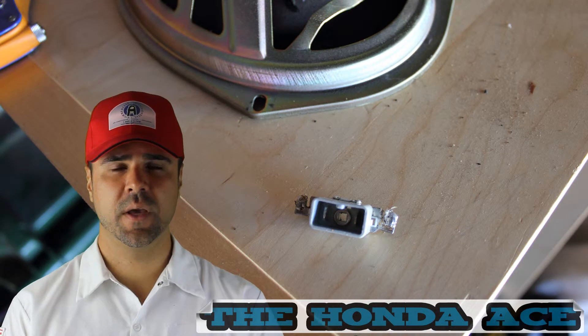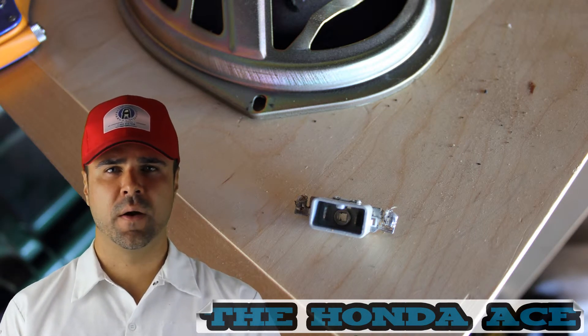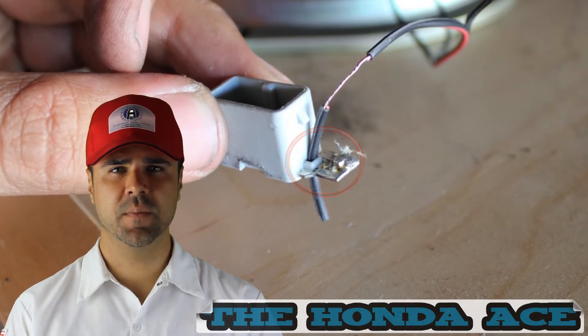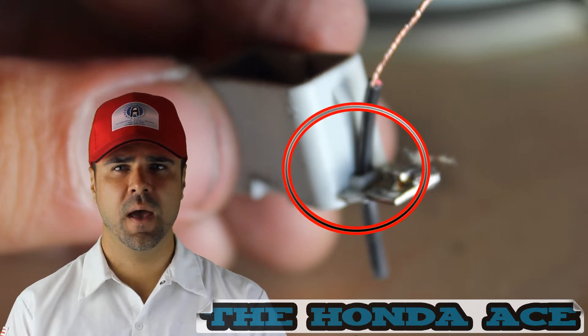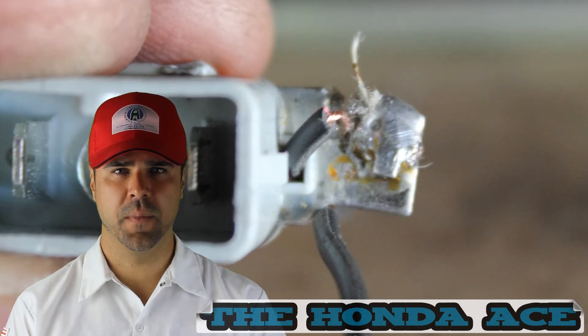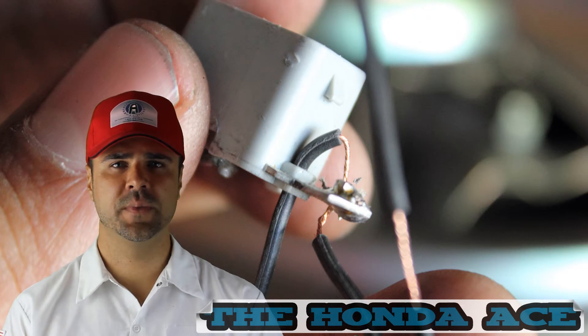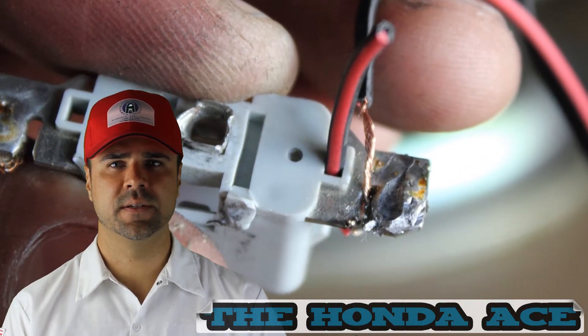Here's the tricky part. Earlier we stripped the wire with about an inch left on it — this is going to hold it in place. There's a little hole on the side of the plastic; stick that in there. Now the wire that's exposed you can wrap around the terminal. There should be a little slit where it'll actually slide right in. If you wrap it around once or twice it should be snug. You can use some electrical tape to keep this nice and secure.